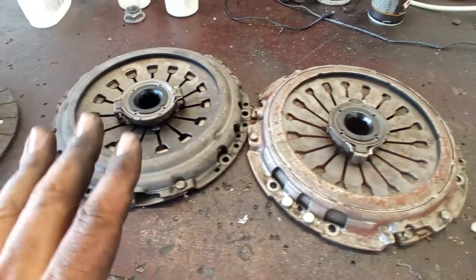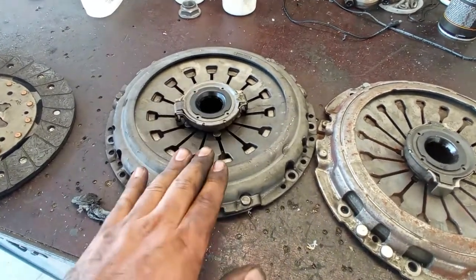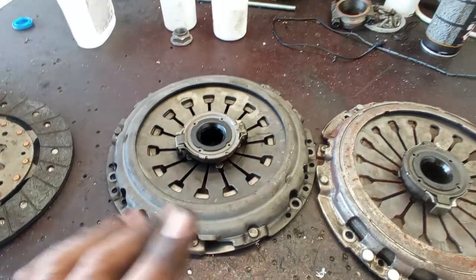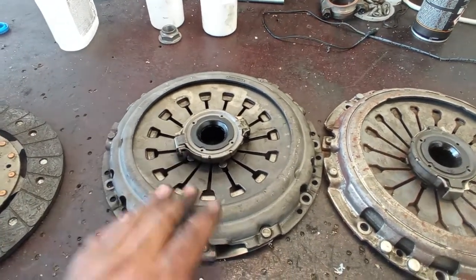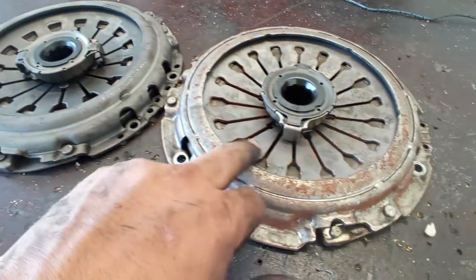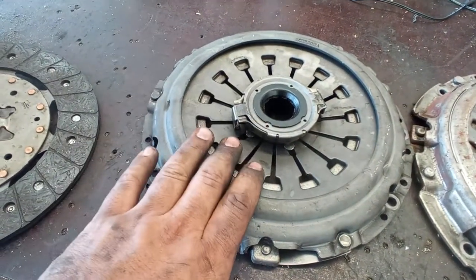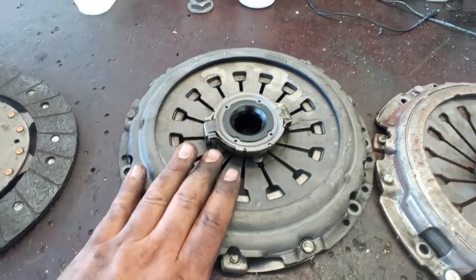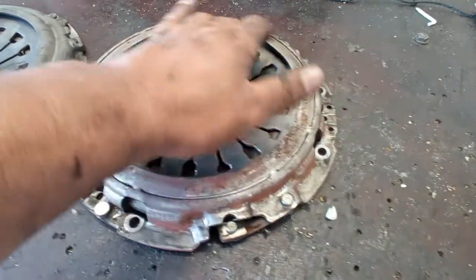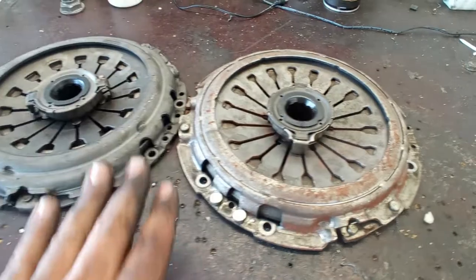Most of the claims that I have on these types of clutches is that very soon it gets very, very stiff. As we remember on that Alfa 147 that I did earlier last year, it is down in the description so you will see, the customer complaint was really this one. Can't you see the difference? Can you count the number of fingers that this clutch has? This one having much fewer fingers, it has to be heavier, because the same fingers have to do a lot more force. If the force is distributed over more fingers, it will be much, much softer for a longer time.